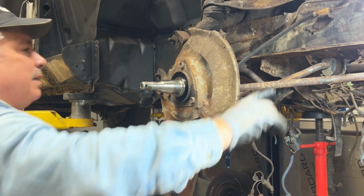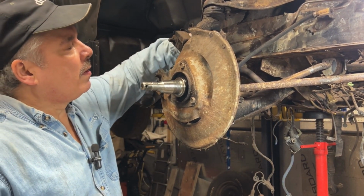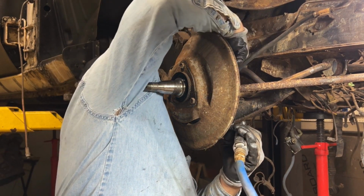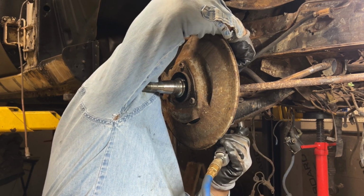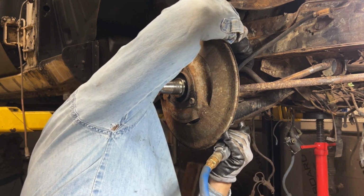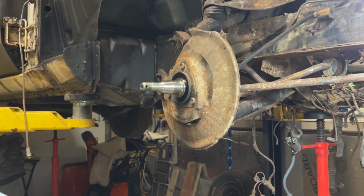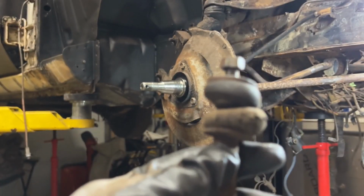Let's disconnect the stabilizer bar. That looks like 1/2 inch on top. Yeah, she's a 1/2 inch, all right. Let's turn it underneath. I'm just keeping it together because, hey, why not? I'm getting all new ones there. Rubbers are all messed up on it anyways, right? These things aren't that expensive. Look at that, it's all cracked up.